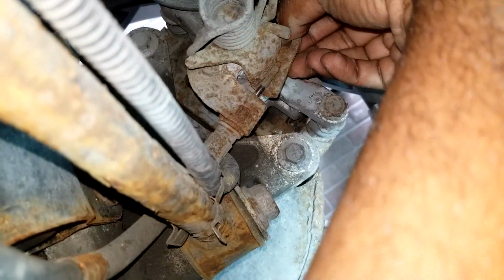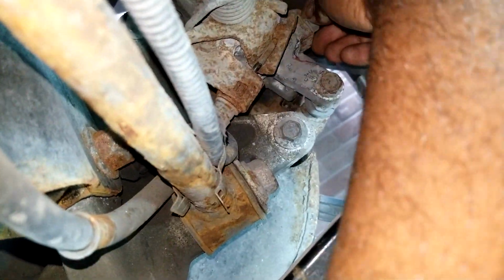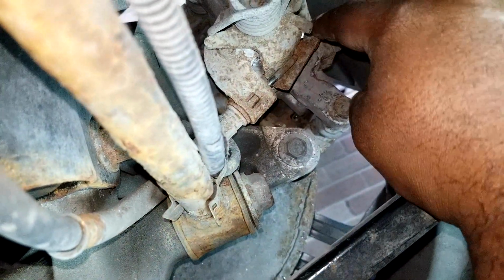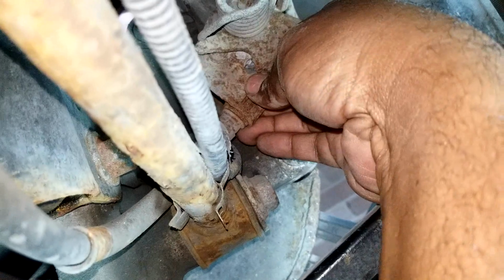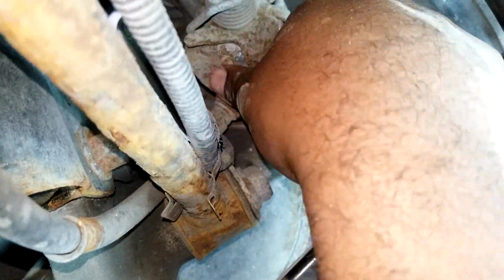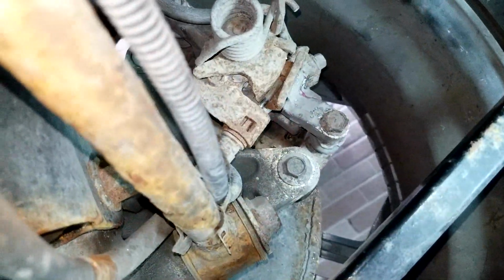Then I took a pliers, grabbed it, pulled, right? Because again, hopefully nothing is seized in here. You'll be able to pull that cable out and then swing it around, and then it comes right through here, and then leave it. Now once you do that, you'll see there's clips here that hold it in place. You do have to release these clips with a flathead or anything. You just push it right in there, release the clips, and then that will slide right out as well. And it's the same for the other side.